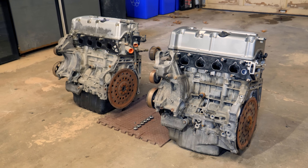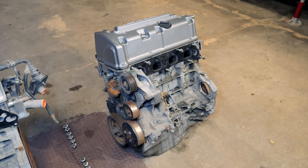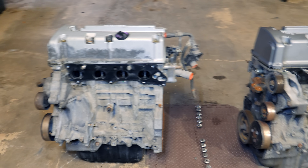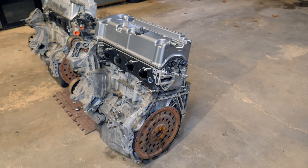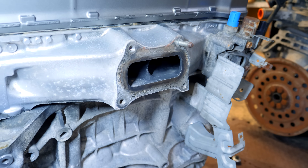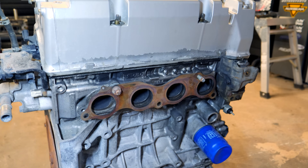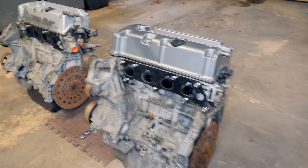For that exact reason I bought two engines to make this process possible. This engine here is a K24 that came out of an Acura TSX, and this is another engine also from an Acura TSX. Both are 2.4 liter engines but they're very different. This K24 Z3 is very similar to the one in my Honda — it's an R40 engine with the cylinder head that has all the collectors built into one. What I'm going to do is take this Z3 block and put the K24 A2 cylinder head on it.